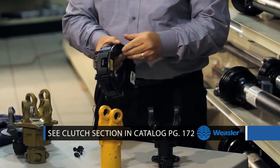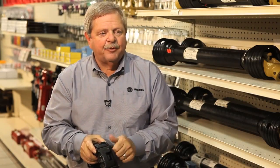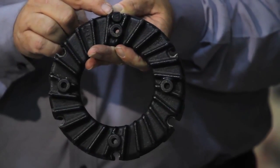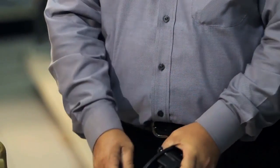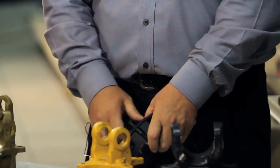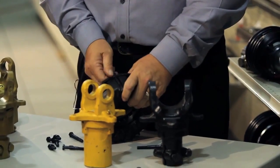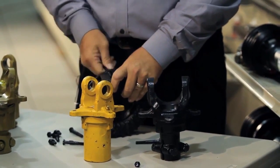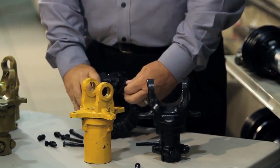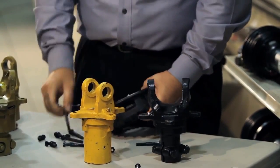If you take this apart, what you're going to find inside is a cupped washer. The only thing needed to operate on this clutch is actually a half-inch wrench — it has a holding place for the nuts on the top. Inside, we have two friction discs that actually rub, and we control where the slip is. If we can control the slip, we can control the heat. We put a knurl centering plate in the middle, and the plates only slip on the outside on the surface that's backed up by the air fins. So when you're using this clutch and you slip it, the heat is actually dissipated by the fins.